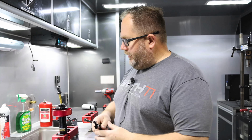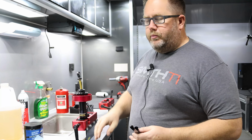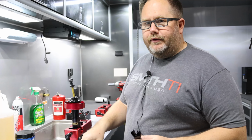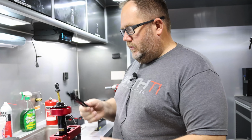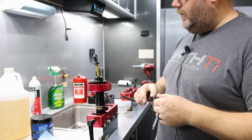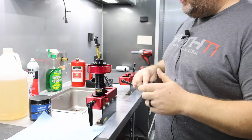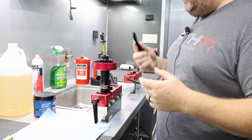It's not super complicated, but the first thing we're going to need is a vise to clamp the shock and a drip cup to prevent oil from going everywhere and making a mess. You'll need a rod guide wrench, which you can purchase from us to fit our shock and get the thing apart. So this is just a customer shock with a bent shaft, and we'll dig in.